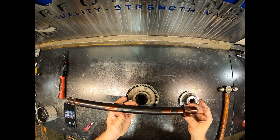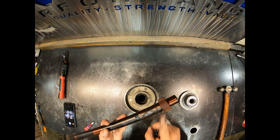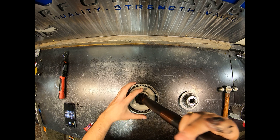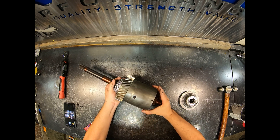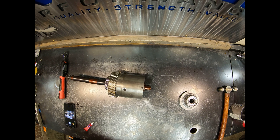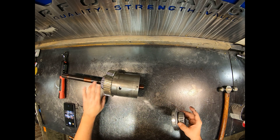The next part is putting our output shaft in. There are a couple of areas to lubricate in case they contact anything inside. Put a little grease on there — doesn't have to get too serious. When you get your transmission fully assembled, you'll want to grease the area where your thumb is because that goes through the seal. This is a little tricky — you put this in but you also need to make sure the other components don't fall out, then get these splines to line up. They should go right in, but quite often it takes a little tapping to get fully seated. Make sure it's fully seated or you'll find you can't get the cap on.